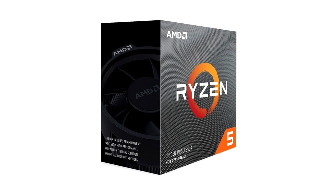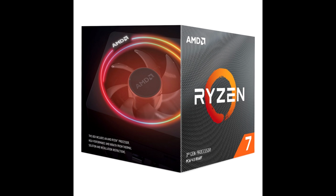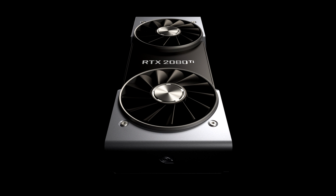Obviously, I wouldn't want to compromise anything when doing a quote-unquote upgrade, so to at least keep the same core and thread count, I'd switch to a 3700X if I was primarily just gaming with my computer. That would have allowed me to get a boost in single-core performance, while our multi-threaded performance would also increase by a considerable amount as well. Then you could spend that money saved on much better memory or a GPU upgrade, where you'd probably see more noticeable changes when it comes to gaming.